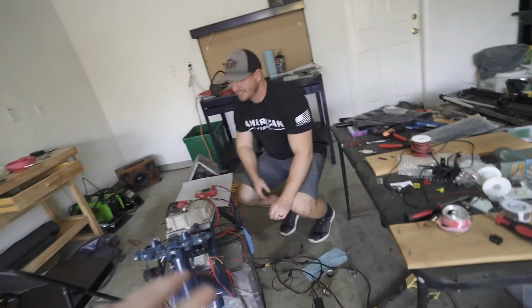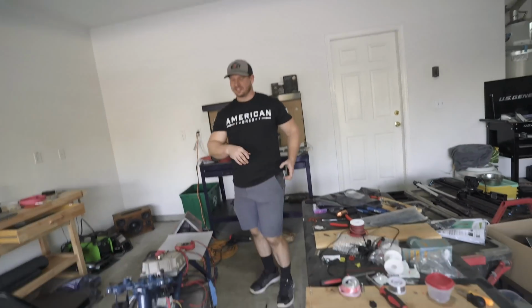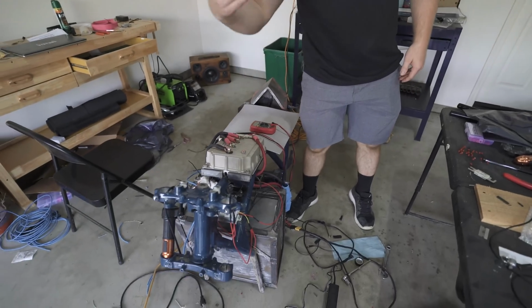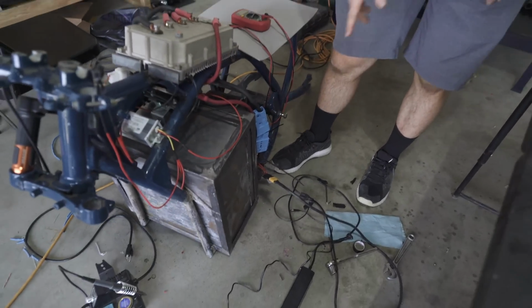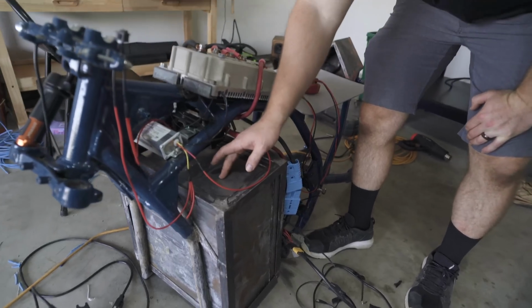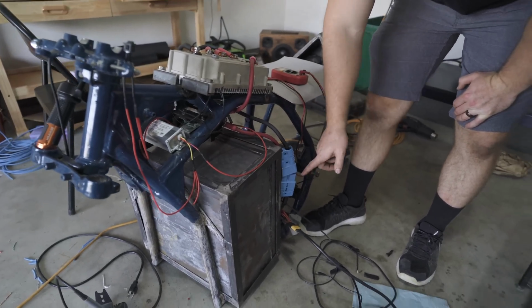Let's just do a really quick recap of what just happened. Battery voltage was 14 when we saw it, so we couldn't get it to pull enough current to keep the contactor closed, so it kept flipping on and off, which was the problem we were seeing. We couldn't find any other issues; we tested the voltage, and that was the issue. We couldn't get it to charge because the BMS wouldn't power up through the charge port, because the voltage was way too low, so it wasn't allowing any charge into it. So we had to start charging it through discharge.